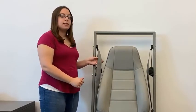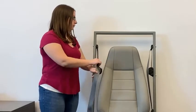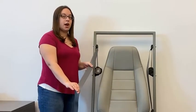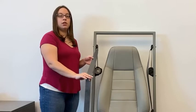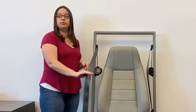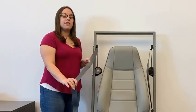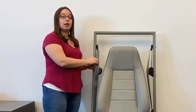To do this, pull on the seat belt webbing slowly until you can't anymore. Then feed the webbing back into the retractor — you may hear a ratcheting or clicking sound. You know the retractor is locked if the webbing will only shorten and not lengthen any further. To reset the retractor back to emergency locking mode, you must feed the webbing all the way back into the retractor, and it will then unlock and flow freely again.